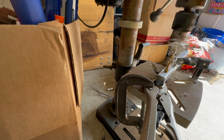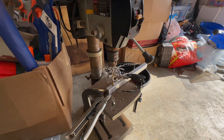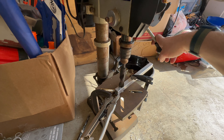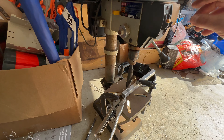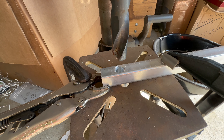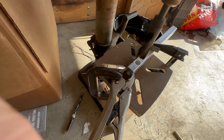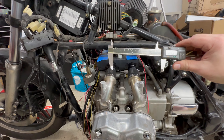Just making sure I haven't burned all the way through yet — and I think I did. Yep, all the way through. I've got a 15/16ths in there — I just want to kiss this to get the burr off and give a little chamfer for the injector o-ring to go in nicely. It's not a very smooth burr but it'll do. That's all I'm gonna do to it — it's a little jagged, very jagged actually, but it'll do. Maybe a deeper tool would have been better but it just needs to get the injector in there smoothly. Maybe I'll try something smaller on the next one.